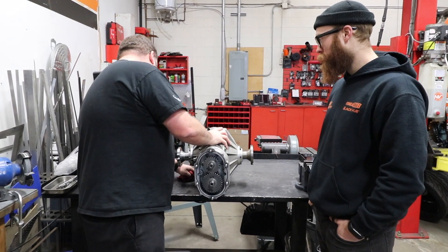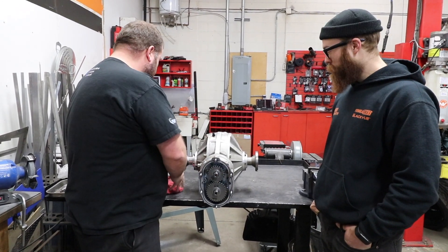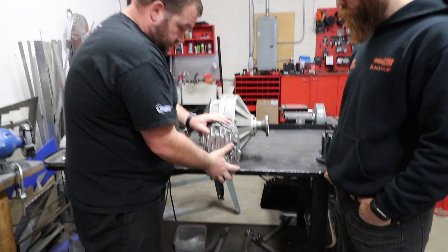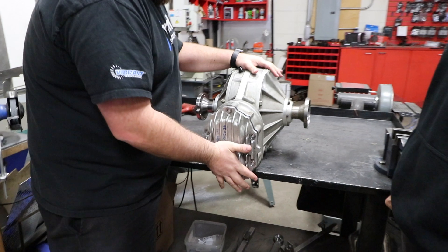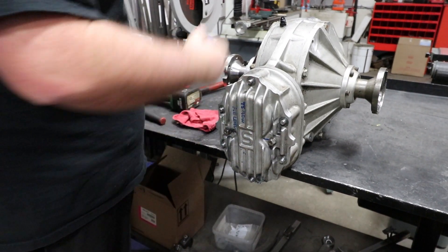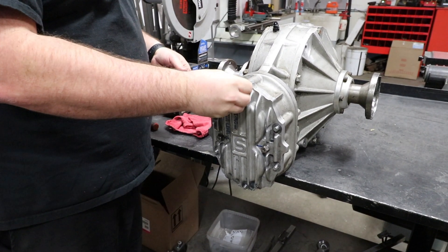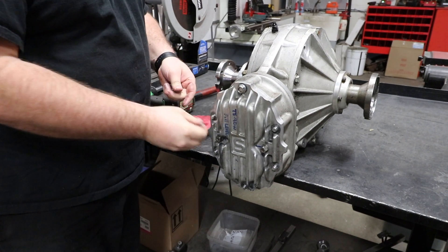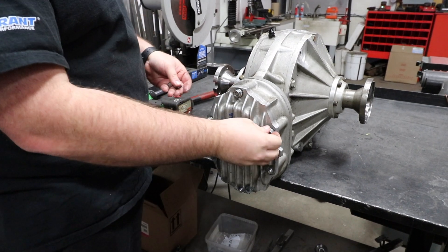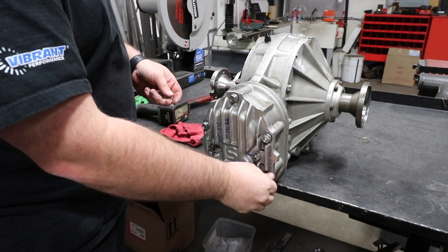That's how hard it is to change the gears — you put the gears in, slide them on, slide the cover back on, put the bolts on, and at that point somebody will be at the reservoir on top of the car already starting to refill whatever oil came out. The crazy thing is how little oil it actually holds given the size of the diff — it holds about one liter.